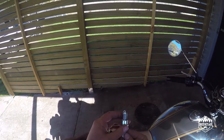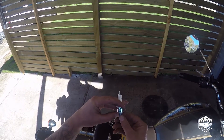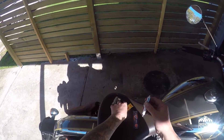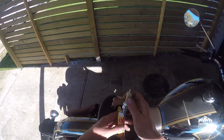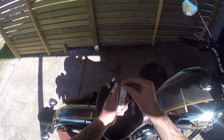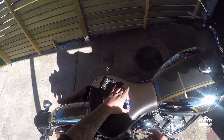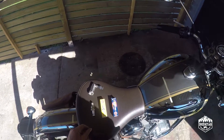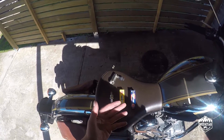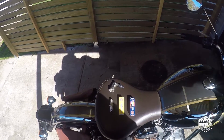This one is brand new — I bought it as a spare — and you can see it's the BP6ES, gapped and ready to go. It will run at the correct colour, particularly if you're riding around town. It takes out the stuttering and hesitation that the Bosch plug causes. It's a much more free-revving bike; whilst it doesn't provide any extra horsepower it sort of feels like it does, and it's a much more enjoyable motorcycle to ride.